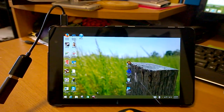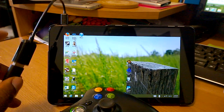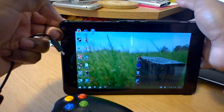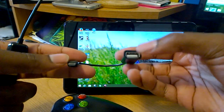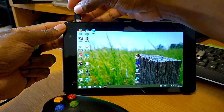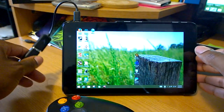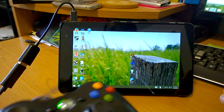As you can see, I have an Xbox 360 controller plugged to the Venue 8 Pro via a USB on-the-go cable. The Venue 8 Pro comes with a micro USB port, so you cannot plug USB hardware directly to it. But what you can do is buy one of these handy USB on-the-go adapters — they have micro USB on one end, full-size USB on the other. So once you get that, you plug it to your Venue 8 Pro and then plug your USB hardware, which includes the Xbox 360 controller, soon-to-be Xbox One controller, or any other device.